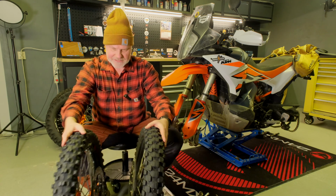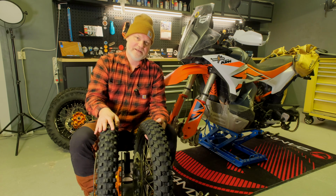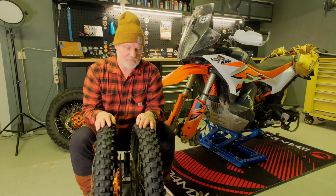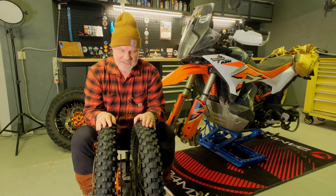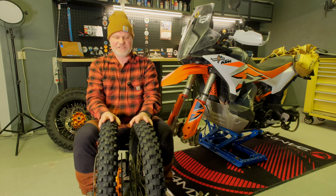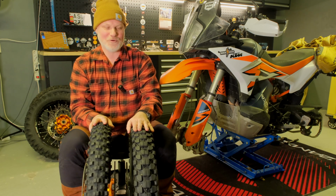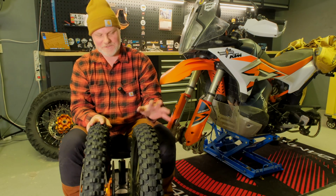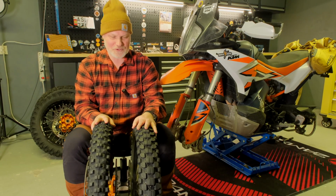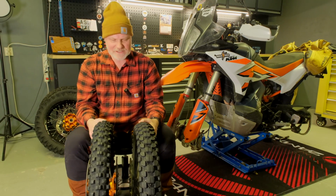So what this actually does to the wheel, when you go from a typical tubeless tire to a typical tube type tire on a narrower rim, Michelin Trackers compared to the Motoz Desert, you see a significant difference in the shape of the tire. I hope we can see that in the picture, and that makes a huge difference when you ride off-road. This is a very typical on-road oriented dimension. You see a very flat surface like this, or shape of the tire, really great on-road, on curvy roads and whatever on asphalt for the sporty rides there.